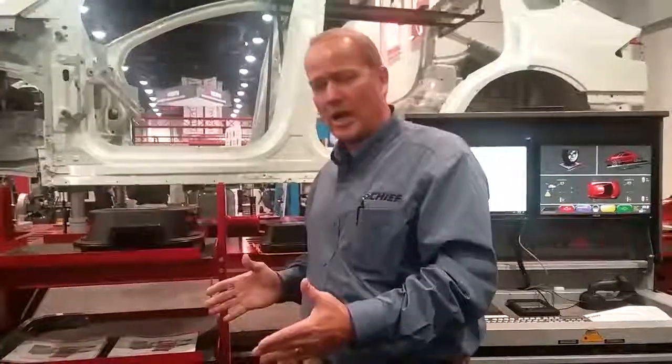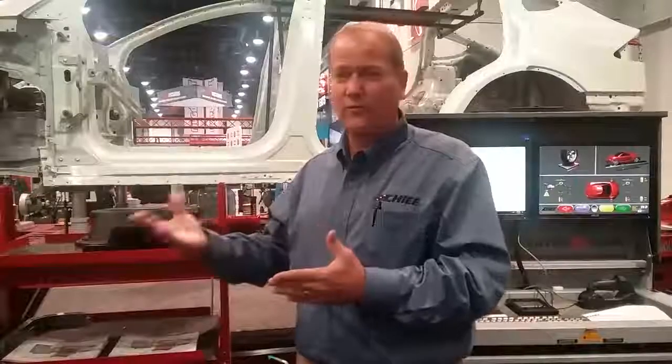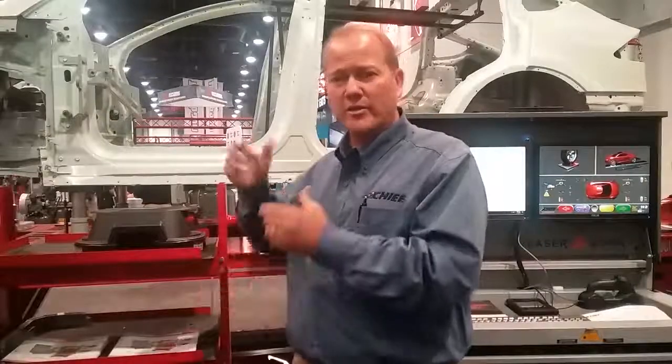You can do alignment in the shop area. You can do it on an existing four-post if they've got an older alignment rack. You can actually set this up on a two-post, do a quick check and freeze those, raise it up, do a couple of adjustments, set it back down, and go through and actually do the alignment there as well.